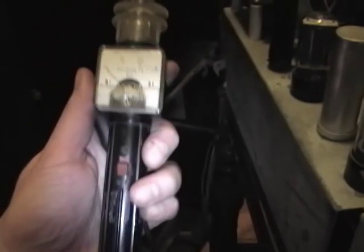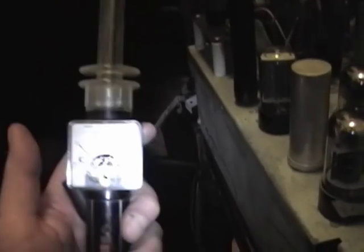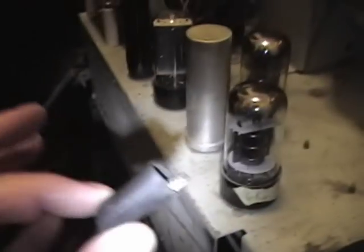I should point out something about safety — you should never do what I'm about to do, which is run this without covering back up the high voltage box and having the safety interlock on. Normally all that high voltage stuff would be under this big steel box. I've worked on a few TVs and I'm going to stay away from that area. If you ever want to measure the high voltage output, you can use something like this — a Pomona high voltage probe that goes up to about 36,000 volts. This set runs at about 9,000 volts, so it's well within range. You clip the ground alligator clip to ground and use the probe.